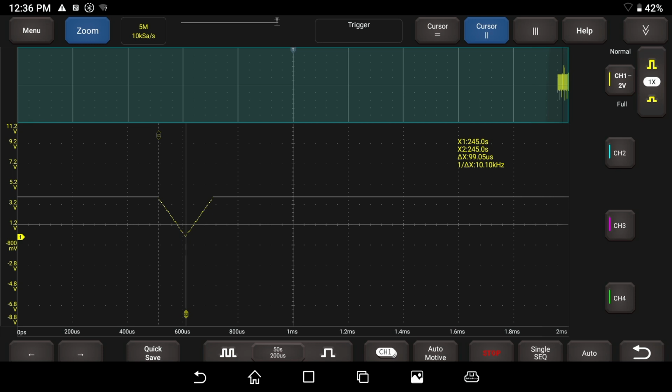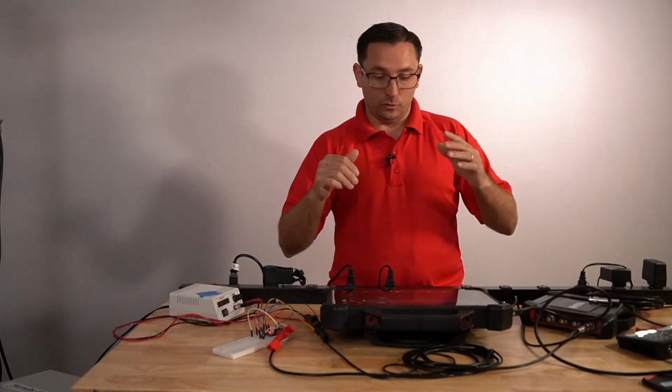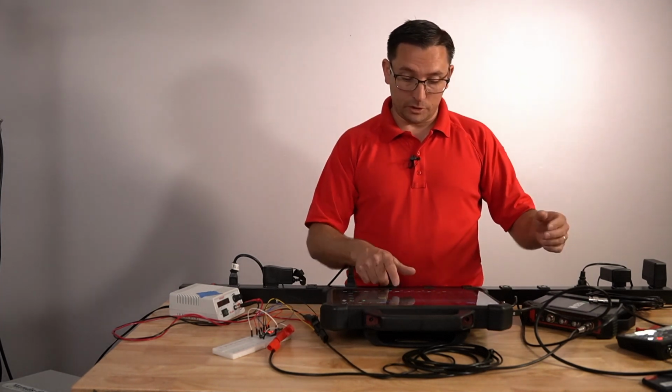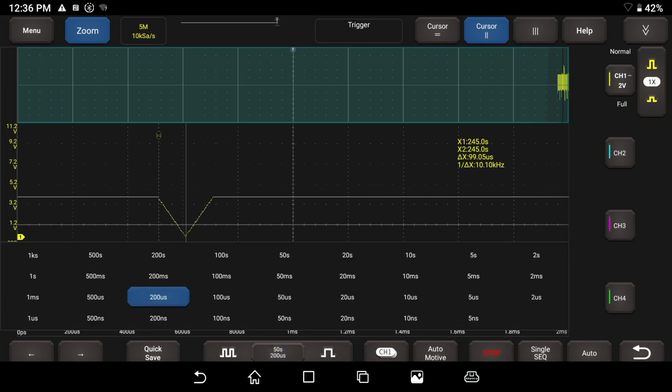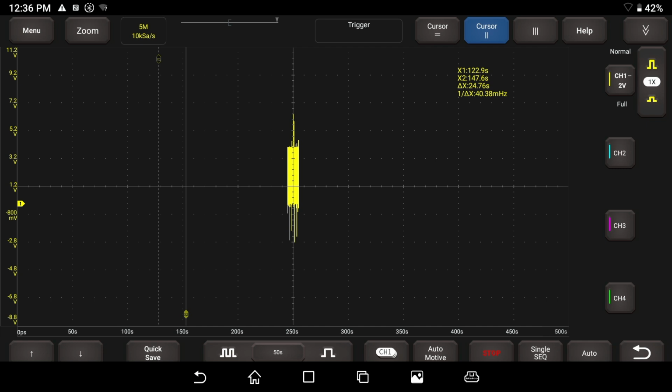We're at 10,000 samples a second, but we had way too much time on the screen. If you have too much time, you're going to lose your quality. So this is really something I would never do. Like I said, this is way too much time on the screen. Let's go ahead and get this back to something normal. But I just wanted to show you guys that you can actually really overwork the scope, and that's when you lose all your resolution. So turn off my zoom. Always have your zoom off when you go to change your sampling.